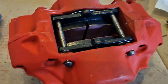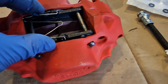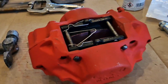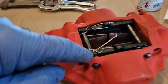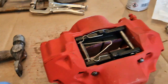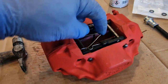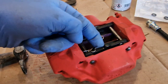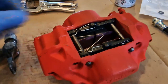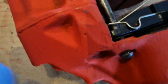I got my R-clips in and then realized this piece is missing — I think it sits below with the bar going through these two holes, which holds it all together. So I need to undo that pin, slide that piece in, and fix it in there. I've got the pin in now, and I need to get the R-clip back in. The two springs sit on top and push them in, keeping the whole lot spread out. Looking at a few videos online, a lot of these springs seem to be missing on other guys' assemblies. The springs are sitting above the disc, the two pins pushing out the center so it sits proud — then it's just hooped around the pin. We just need to finalize this by inserting the last R-clip into the little hole down there.